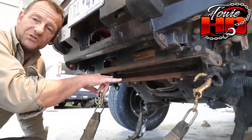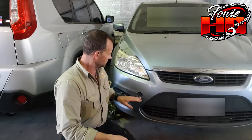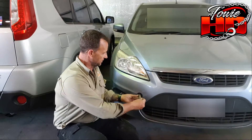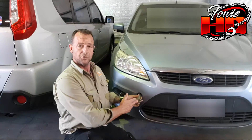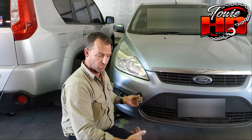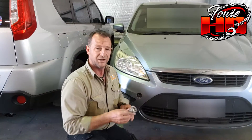The only real thing I would use these tow points for would be to pull it onto the back of the truck, provided that it's a free-rolling vehicle and it's going to pull up there quite nicely. Now unlike the Ranger, looking at this Focus here — you can see where the tow point screws in is actually quite a ways off to the side of the vehicle. When I pull this vehicle on using this tow point, it's not only pulling forwards but it's going to pull down, and the closer it gets to the winch the more it's going to pull down and across. That is not good, and it's just not made for that. Not to mention this particular tow point has got no load rating on it at all — I wouldn't hang the string off a balloon off this thing. That's the amount of confidence I have in it.